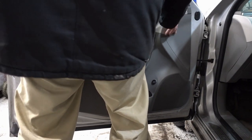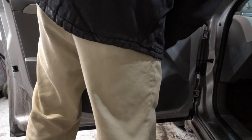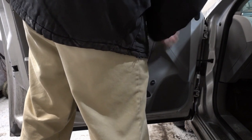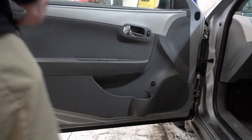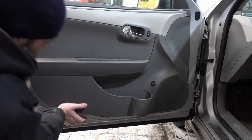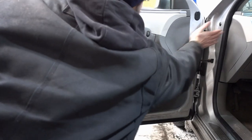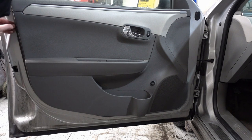And so when you put the door panel back on, it's kind of like a J hook that goes over the top of the door frame itself and then kind of hangs down off the top, and then there's a bunch of clips on the outside. And usually, give it a firm slap with the palm of your hand. Kind of do it all around the edge, kind of like I do here. There's 1 or 2 or 3 or 4 in total. Yep, and you can kind of see it slapping in place, and everything is good to go.